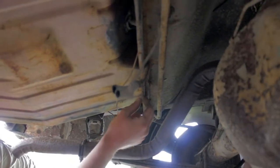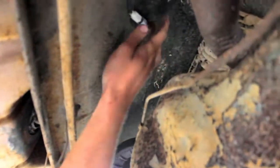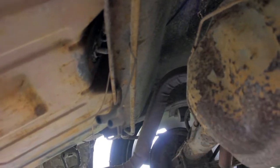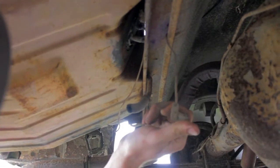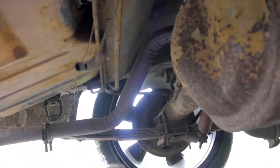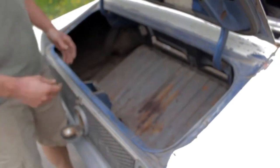First time I've been under here — this is really solid, dude. I mean there's a lot of surface rust but this car is really solid, not nearly what you'd expect. It's definitely not pretty but it's good. You just unhooked two things — pop the fuel line off, pop the sending unit wire off for your fuel gauge — and I thought it was going to be a little more intense under here, but I think we can get it out like that. We can try to finagle this thing out.